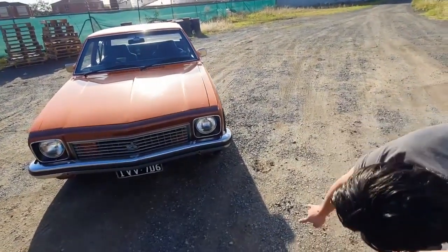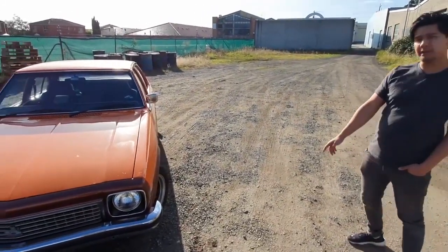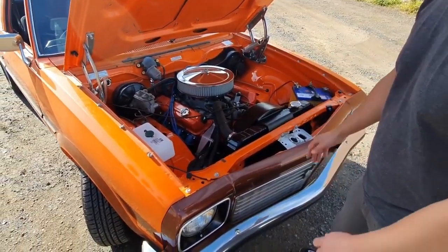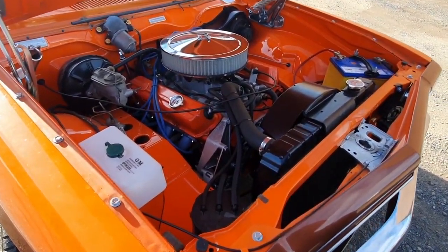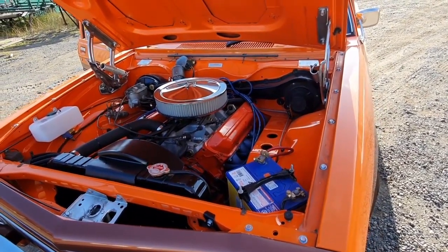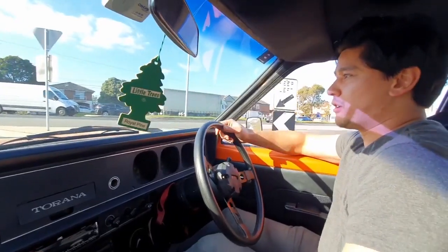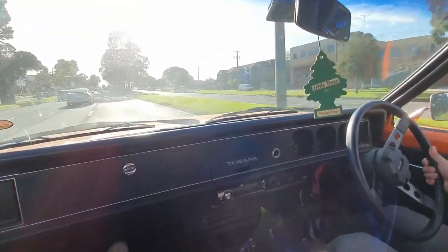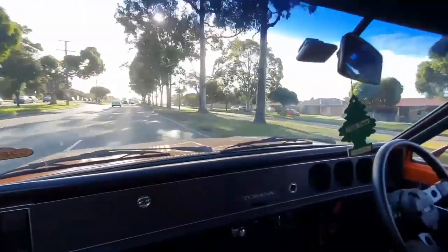What I've done is I've installed sway bars down the bottom. It did have a front apron over here. 13-inch hot wire rims, and I will be respringing the car in the near future. It's a red 308. It's got a 286 cam — it's lumpy. It's had head work done, still runs the early heads. It's good for about 300 horsepower. Let's go for a little bit of a squirt. Yeah, she definitely boogies.